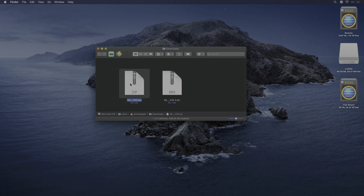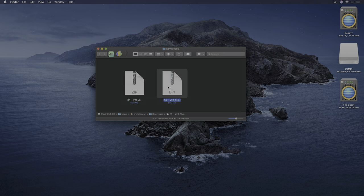Your browser will download a .zip file which may auto-expand to a .bin file. On macOS, you may actually see a dialog telling you that it can't further expand the .bin file — ignore that. What you need is the .bin file. Take the .bin file and copy it to the root level of your freshly formatted SD card. Eject that and now let's go put it in the camera.